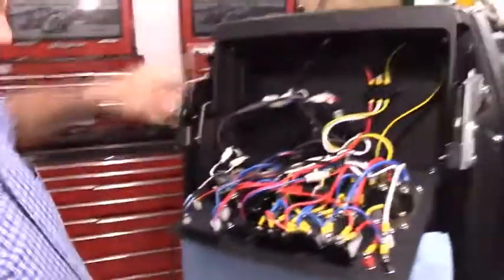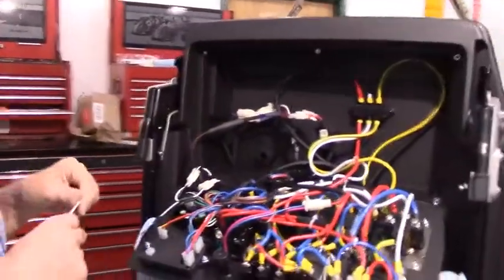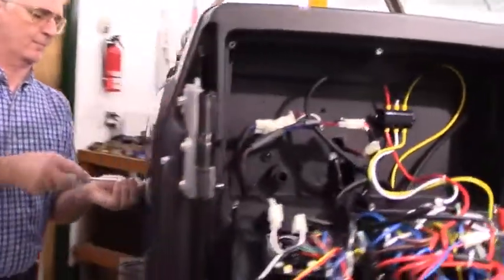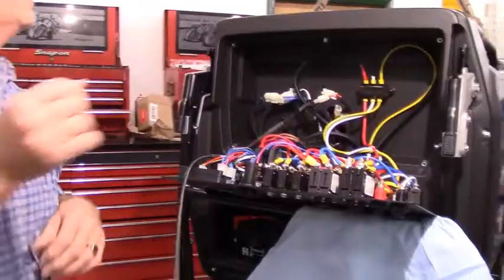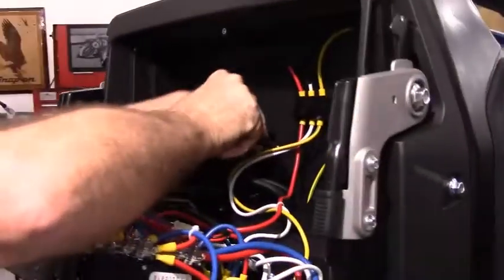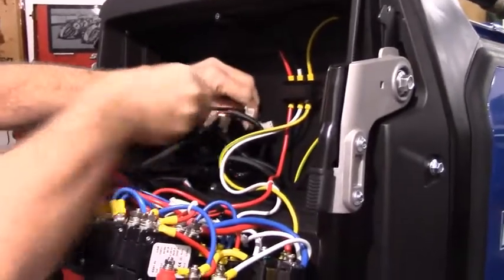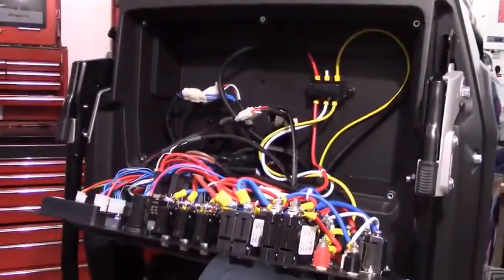You can either put a notch around this or run it through the back. I prefer to run it through the back — that way you're not going to be cutting any fresh new holes. So we're going to feed this wire back out through the hole for the three original wires from the micro-switches onto the fuel selector valve.